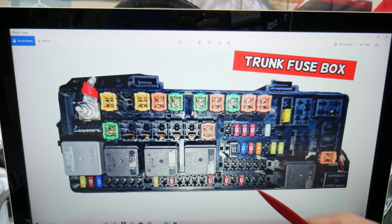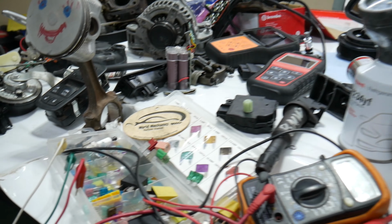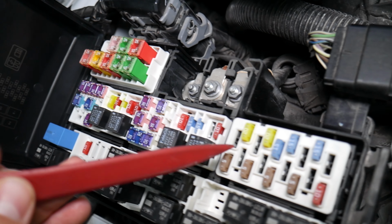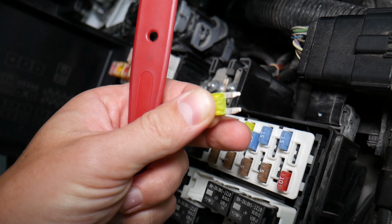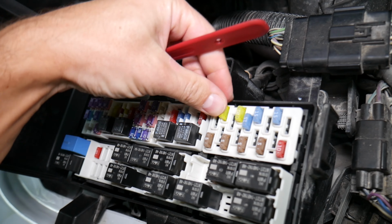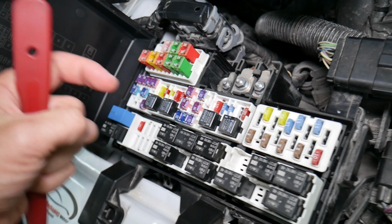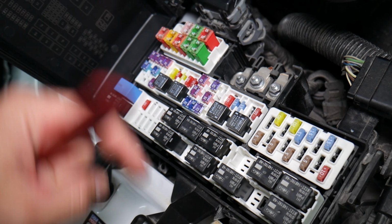Squeeze the tabs together, pull that cover out, and you're going to see a fuse box with a layout like this one here. Before we continue, let's explain quickly why it's always a good idea to test fuses and relays. It is very important to test them. On those fuses, you cannot always clearly see if they're burnt or not. If you remove a fuse, look at it, and assume it's good, but it's actually a bad fuse, you can put the bad fuse back in and start replacing parts and tools that you don't need to. So you lose your time and your money to fix a problem that doesn't exist, when all you had to do is test the fuse and replace it. We'll put a link to a special video that will teach you how to test fuses and check relays very easily. It will be in the description of the video below.